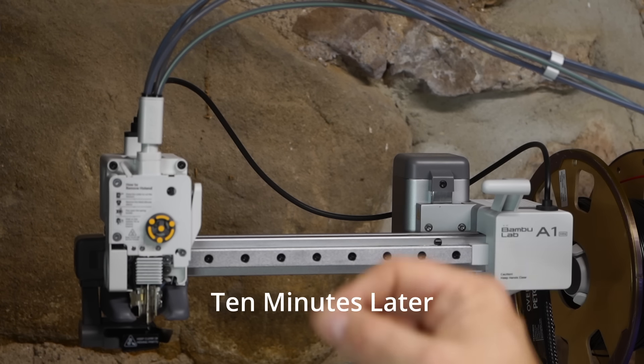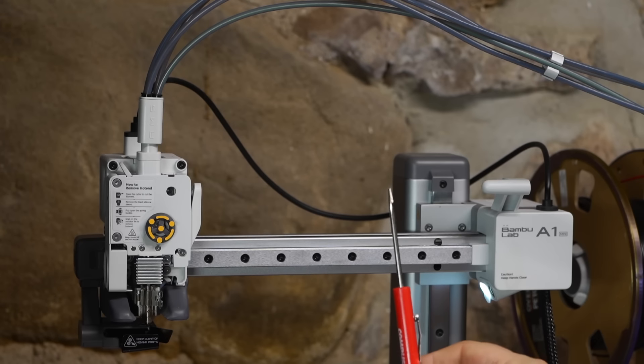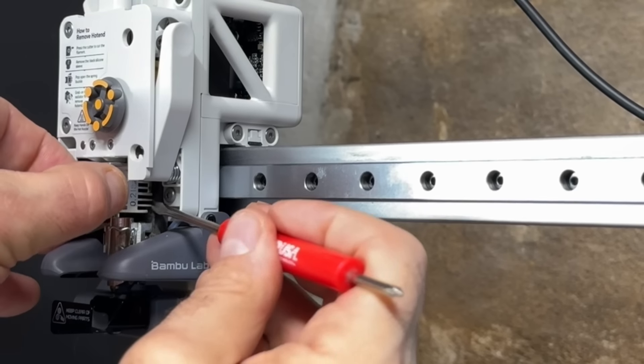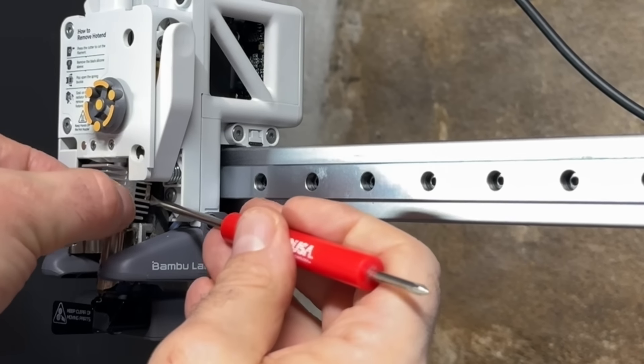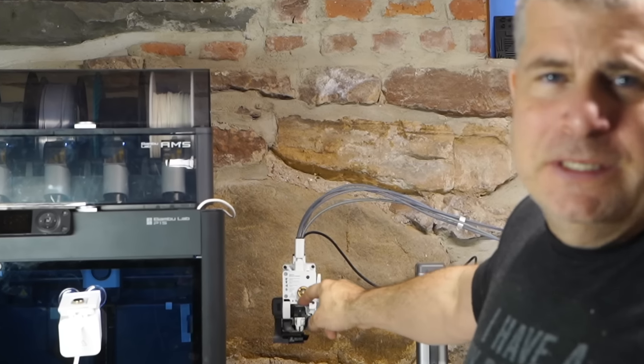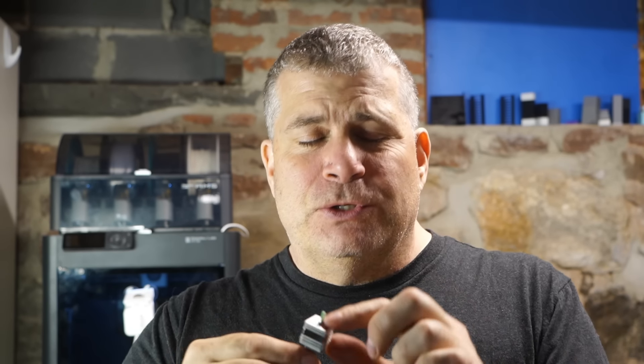The system is cooled down enough that I can take the nozzle out. Sometimes it's really tightly in there and you won't be able to just pull it out with your finger. Let's go back to that screwdriver I said not to use before — this is a case where we are going to use it, but only gently and only if we can't get the nozzle out by itself. Very gently, there's a little space behind the nozzle where the screwdriver goes in, and while you're pulling on the nozzle you can just give it a little nudge. What was making it so annoying is this bit of filament sticking out at the top — the filament cutter cuts it off up into the printhead, and if that piece has cooled down, it often will not come out.